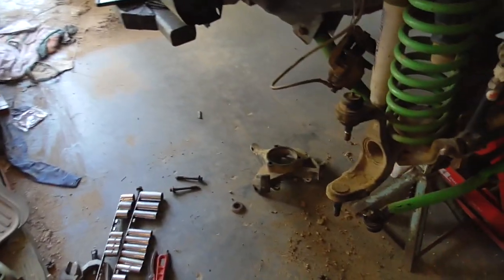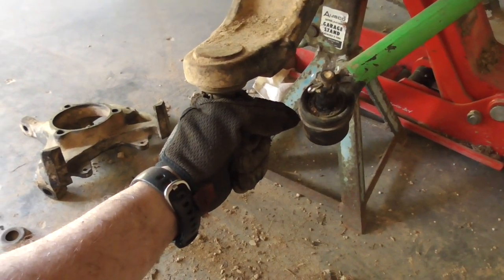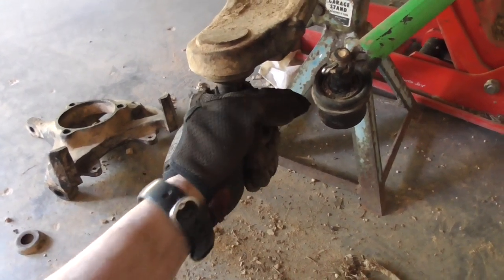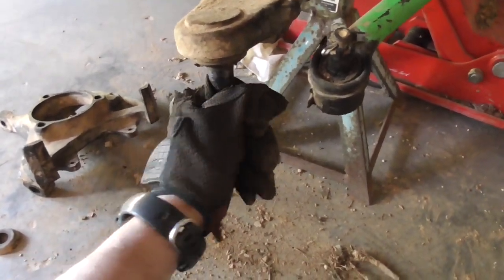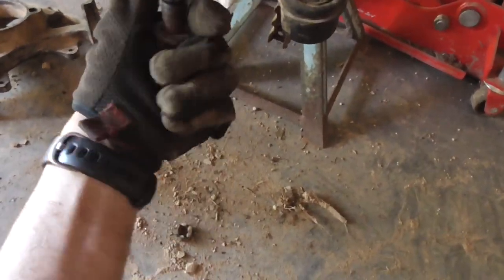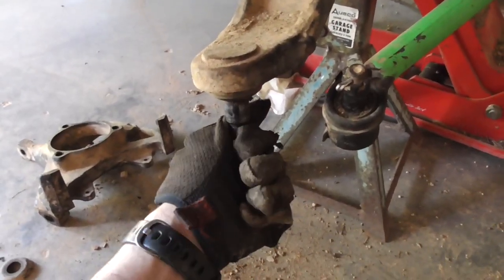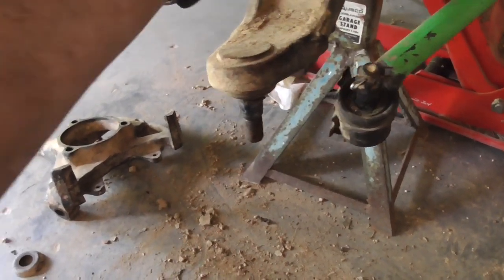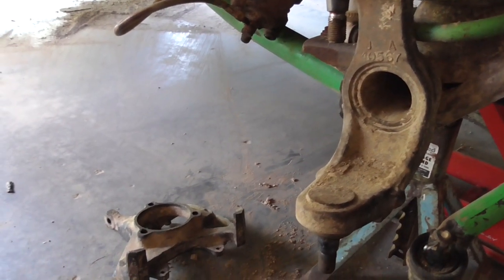Yeah, well, I thought I pressed record, but I guess I didn't. I just recorded a couple of minutes and noticed it wasn't recording. But lower ball joint seems pretty loose. Then again, the nut stuck to the bottom. No matter how much I turned it, it started moving. It started just spinning the heck out of the bottom with the impact and hammering on it, and it finally came loose. But that looks loose. The upper one looks pretty tight, so I'm not too worried about it.